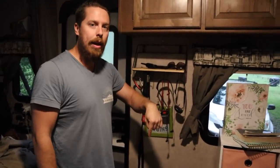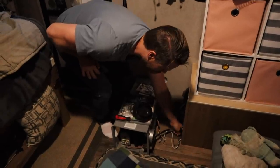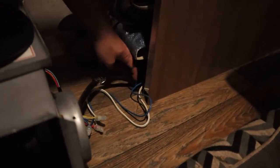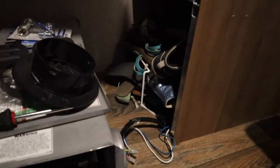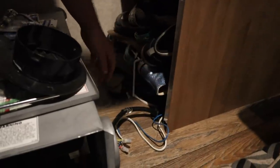And then the propane line, I'm very tempted to just pull it out of the RV itself, because we're not going to use it for right now. I can't really pull it further, so you may have to come look at it. To keep it from falling through, there's actually a zip tie tied pretty tightly around it. You just have to cut that away without cutting the hose. Once you disconnect this, you can feed it back down through. I might even completely unhook this little circular piece, so it's not in the way whenever I put a face panel on this and get you to move your shoes, Blair. I know. And then I can tuck everything back in there. Even the heater that we're not using can just go back in there, after it's disconnected.